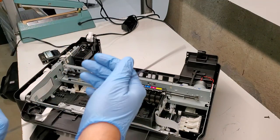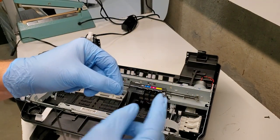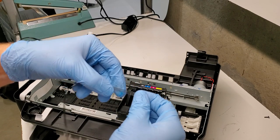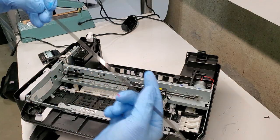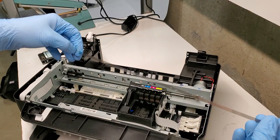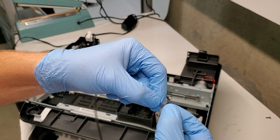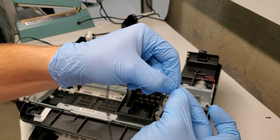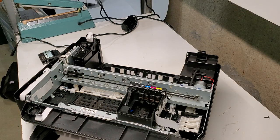had to replace it. If you don't want to buy one, you can always put tape on this side. This side really doesn't matter, the clear side, what you put there, because the printer only reads this black area or the darker area. So it's how I've repaired it before. I just put some tape on here. If it was ripped, I put some tape and just put it through that hole and it just punched a hole in the tape. And it held on fine.